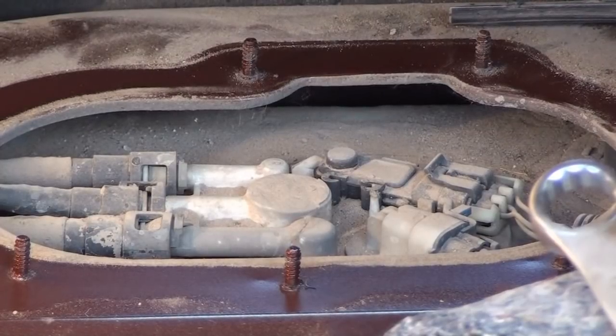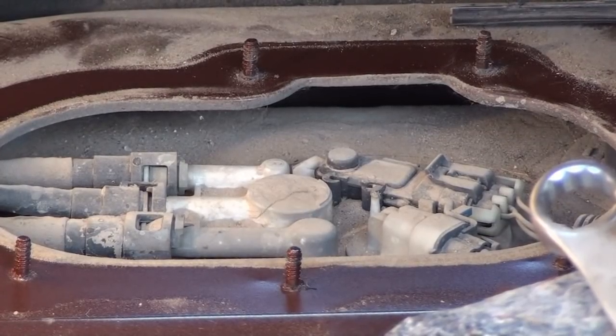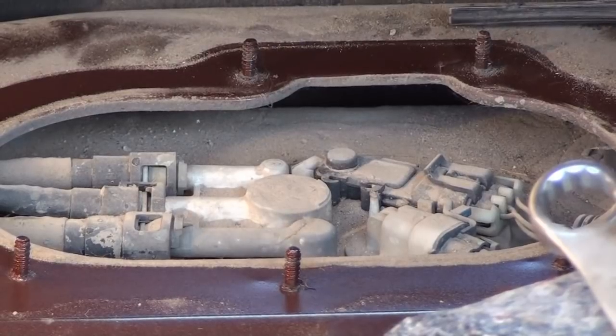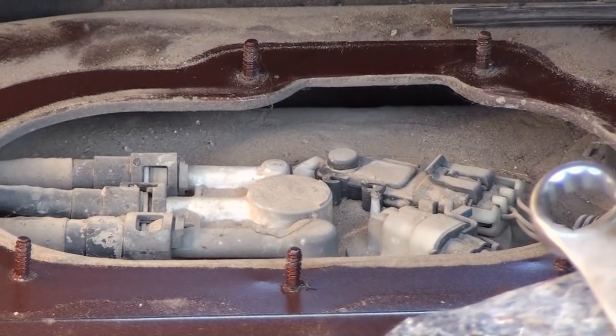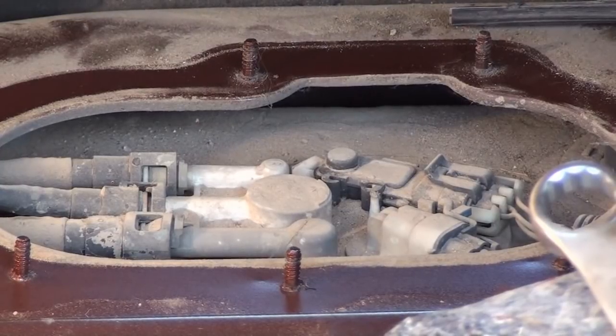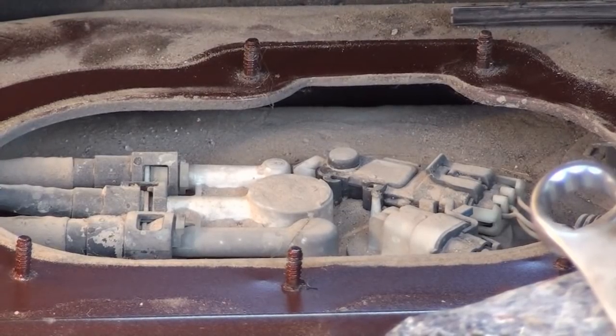The fuel pump looks similar except for the connectors. This one actually has a square connector on it. So what's going to be needed for this new fuel pump, which kind of sucks, is cutting the harness and pretty much crimping the lines. But at least they included instructions to do so. So I'm going to get to removing this pump now.